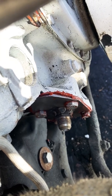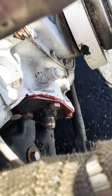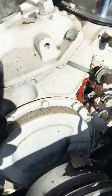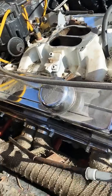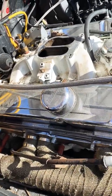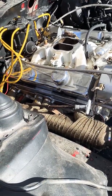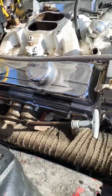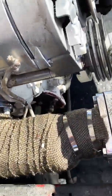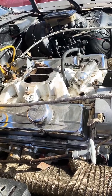I have a 10 AN fitting welded onto there. So it'll come out, and then Y to put both turbos into there. Some people weld them into here on the top of the timing cover or into your oil pan, but meh. I do know somebody who has put them into where your oil filter goes. They've done the relocation kit and bunged them into there. But yeah, this will probably be sufficient for what we're doing. Only gonna run 7-10 pounds of boost out of this safely.